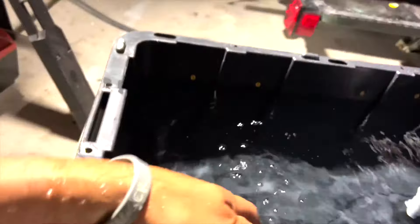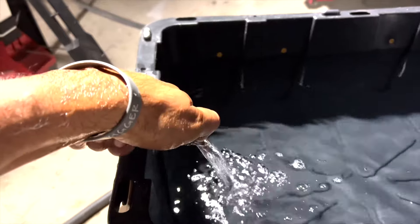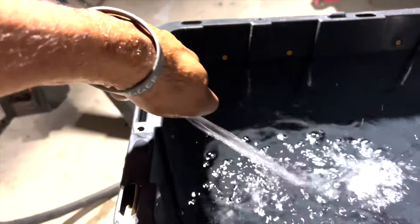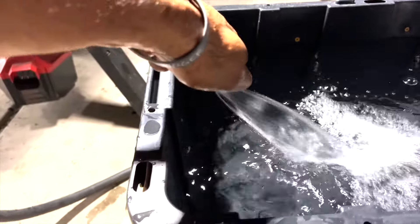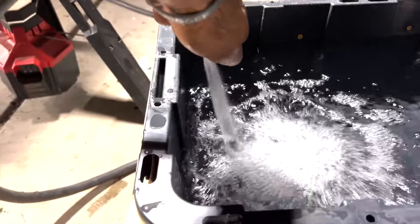This is just a constant drain-and-fill kit. That means when you go on plane, it will stop circulating, but no water will drain out of the pipe because the pipe is taller than everything and can't just bleed out. But once you get back on the water, it'll start filling and aerating the whole thing again. It's a constant refill of fresh water.